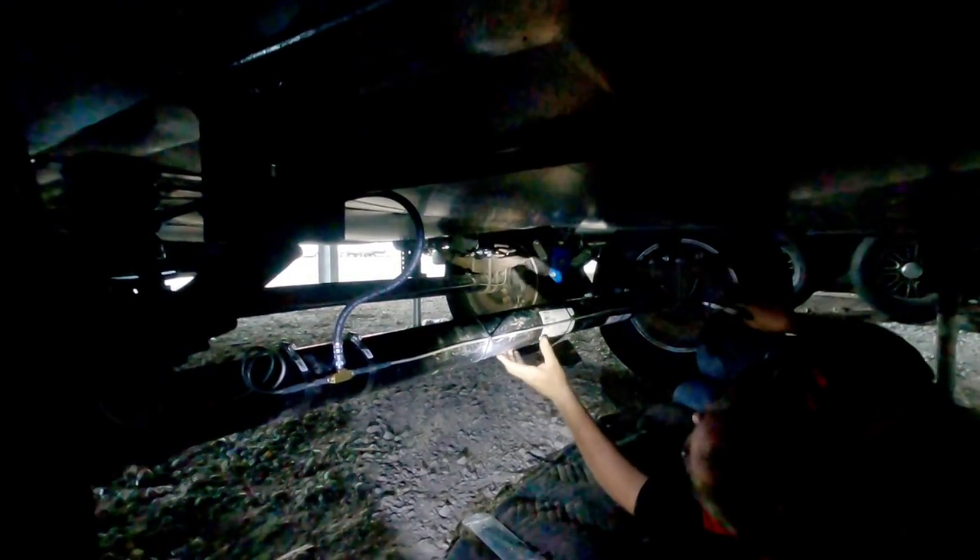You can see the stainless steel clamps in place here, and there's a rubber bushing over the brake line to protect it from the stainless steel clamp. What you're seeing here isn't traditional — this is stuff we discussed and confirmed is fine to do. Don't expect most RV manufacturers to do this level of detail; they might make it look a little different, but it's not necessarily wrong — they're doing it to what Dexter approves. This setup is just going above and beyond with redundancy.